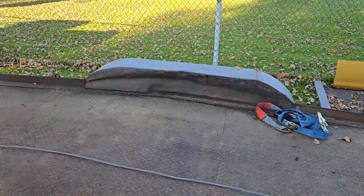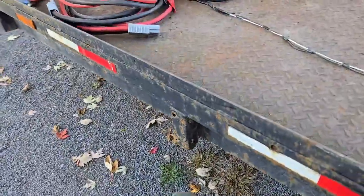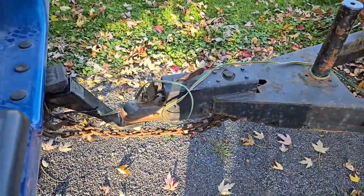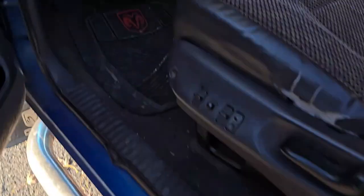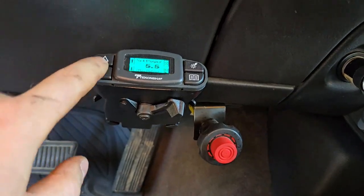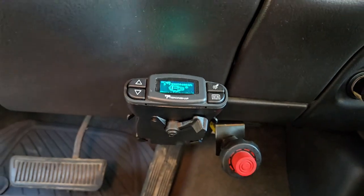There's actually a piece of checker plate steel in the back of the truck right now to fix that. It's going to need the backs of the fenders cut out and replaced because they're a disaster. I'd like to re-weld that section of the deck where it's popping up and fix where it's rotted out. It needs lights and wiring. And the first thing that's got to go is the surge coupler — I absolutely hate surge couplers. All of my trailers have brakes on all the wheels and I use electric brakes because I have a good trailer brake controller in my truck.